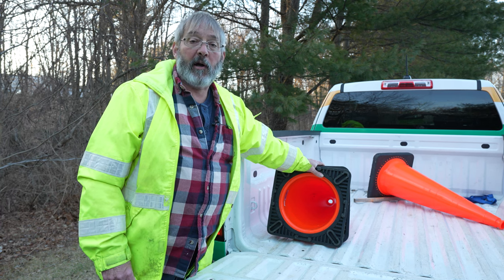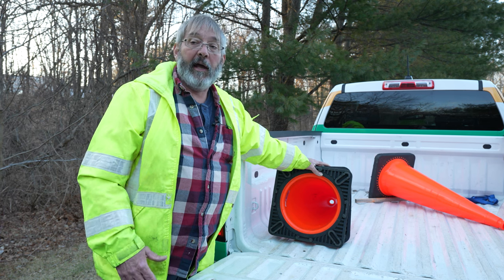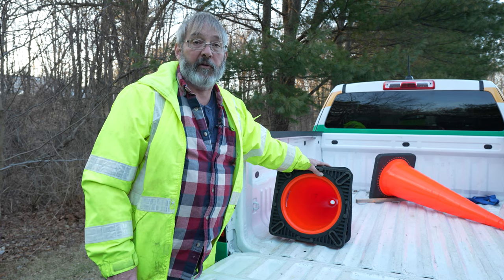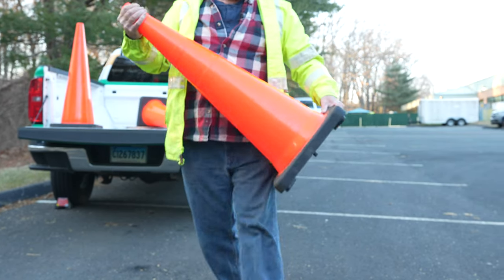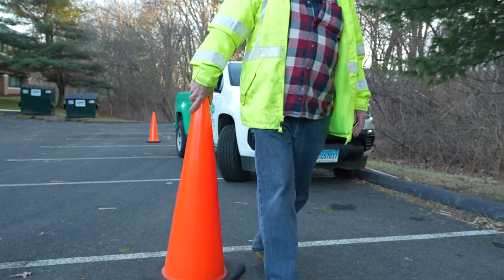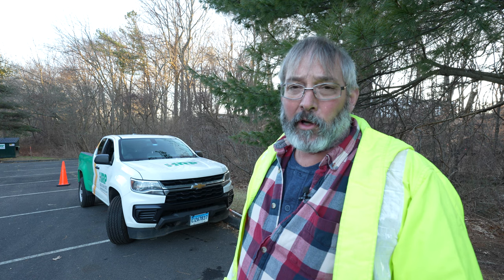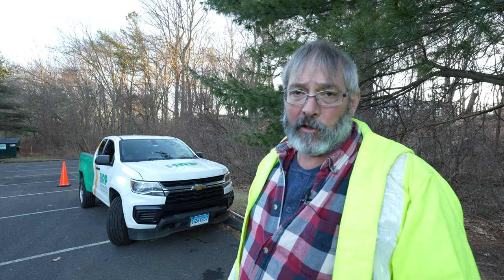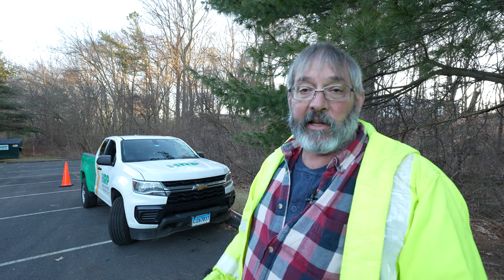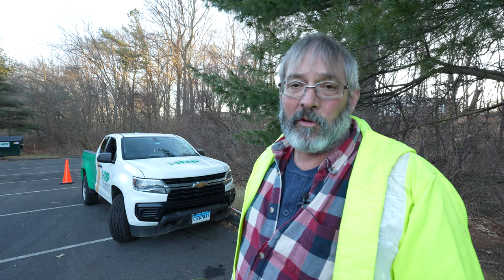Safety cones are not for marked parking areas, parking lots, or garages. This applies when you're on the road doing field work off the side of the road, or making a delivery to a house that doesn't have parking out front. Place your cones a minimum of 15 feet away — 30 feet is even better — on both the front and back roadside corners of the vehicle. The cone makes people aware there's a vehicle in the driving lane. If you place the cone too close, they're going to hit the cone and then hit your vehicle. At least if they're texting and hit the cone, they're probably going to brake and not hit your vehicle.